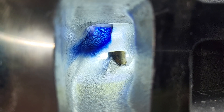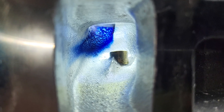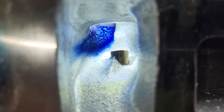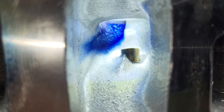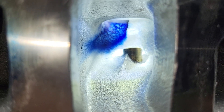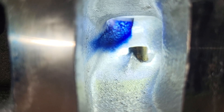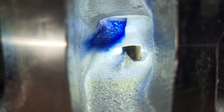It kind of hurts when you're trying to modify it and make it better, because you don't have the flexibility. If you know an area needs more area, there's not enough metal to really make it happen. And it makes it more difficult, because I want to use a relatively rough texture on this — it's going to be a carbureted street application, so I want to keep that fuel mixed. Any places I really think need extra area, I have to change to a less aggressive texture to get an accurate reading on my sonic and then work accordingly.